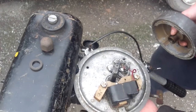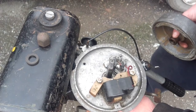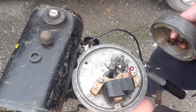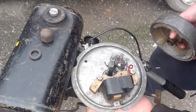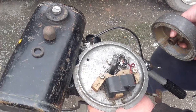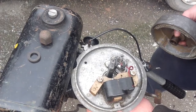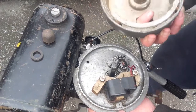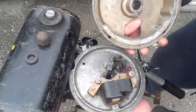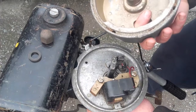If you have a flywheel that's quite stubborn, maybe soak it again for another night or two. Only give it one or two blows — they will have to be quite sharp blows — and do use a lump hammer if possible. I haven't had one that hasn't opened for me yet anyway. Just stick with it, maybe give it another night of soaking if it's very, very stuck. You can usually tell by the condition of the engine whether it's going to come off easy or not. But do try and use a lump hammer.